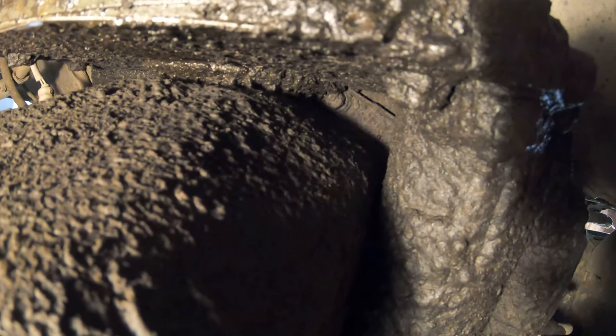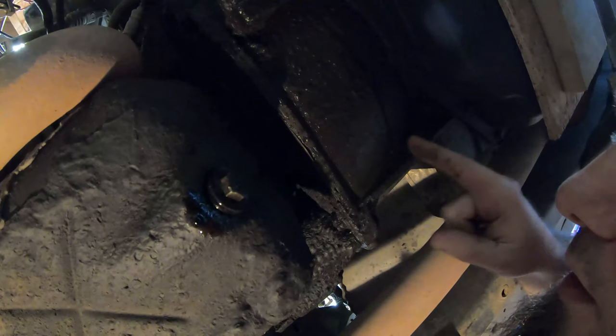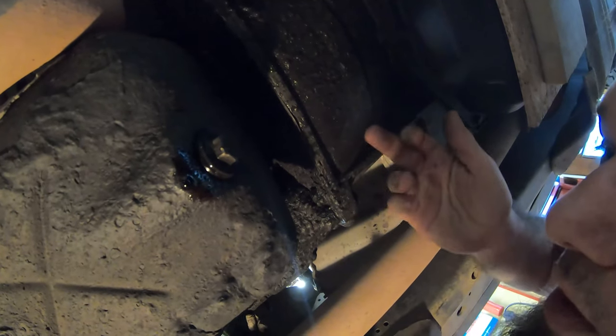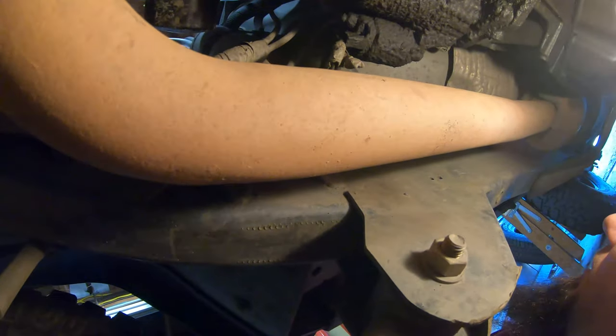We've also got the rearmost bolts on the oil pan that have to come out, and there's a sort of clamp that goes around the back of the oil pan. It would have been easier to get this oil pan off if the bell housing for the transmission wasn't here in the way. So with that there, I'm going to have to get this low enough to get beyond it. And right here is where the exhaust is in the way. I've got some play now with it disconnected, but I kind of doubt it's going to be enough. Here's the rest of all those bolts that need to come out - it's pretty straightforward once you deal with the hard-to-get-to ones back here.